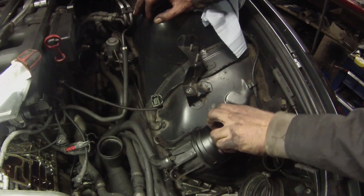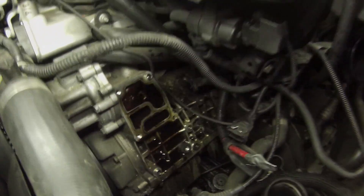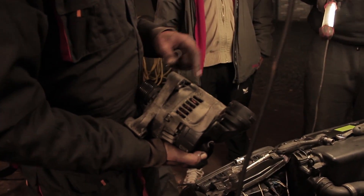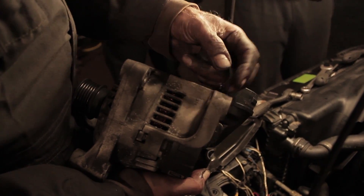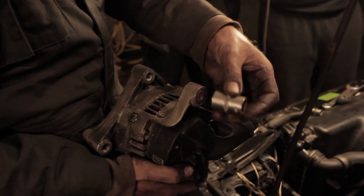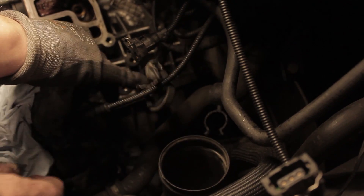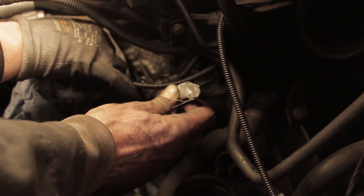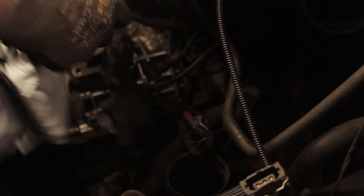First remove the air filter, intake tract off, the reservoir off, power steering. Remove the alternator. The power steering pump is simply bolted with two screws to the oil filter flange — just let it hang down. Then you pull the thing out. When installing the alternator, there's a bushing here that gets pulled in tight when tightened — before installation, put a larger socket on the back and press it back with a vise. Disconnect and remove the alternator — either disconnect the battery or, like we did it, oldschool style — just isolate it, because there's permanent plus on it. Also, my alternator was clogged with leaves — everything was full of leaves.